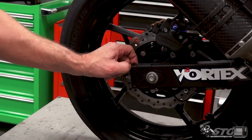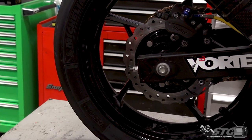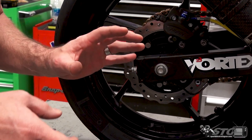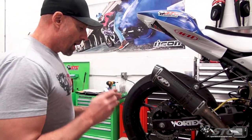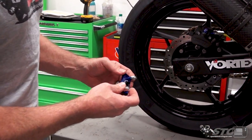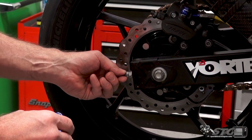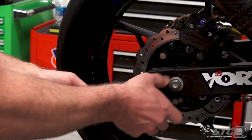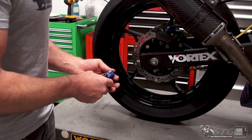This end cap right here — this plate — is not fixed to the swingarm. So when you take and pull the axle out during tire changes, these parts are just allowed to kind of float around, and it's just a real pain to change that rear tire. By installing this, replacing this plate, this nut is threaded, so it will hold on to the stem of the rear axle block — internal inside the swingarm — and not allow it to float back and forth or fall out the back of the swingarm.